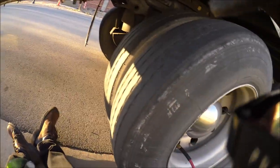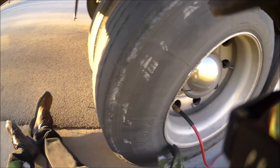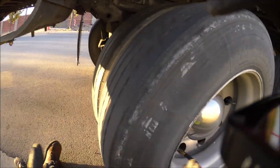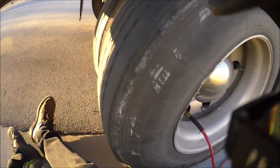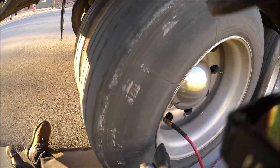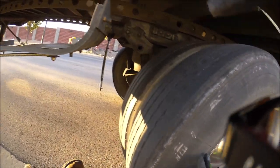If you do have a problem and break the bead, I usually get a board and run the opposite tire over the board to lift it up. Then you put a strap around the middle all the way around, tighten it, and it squeezes and pushes and seals your bead. It's the only way - it's really aggravating. If you go to a tire shop, they thrust air in there - it expands and fills up and works out pretty good.